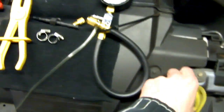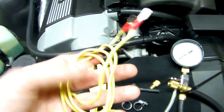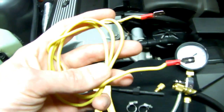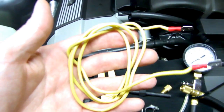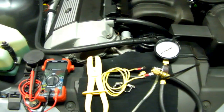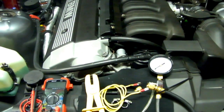The last thing I have is a length of wire with two male connectors on either end, about 12-13 inches — though six inches will work just fine. We'll use this to bypass the fuel pump relay and activate the pump. So we'll bleed down the system to get the fuel pressure out, then locate the pump and run some tests on it, and maybe do some troubleshooting too.